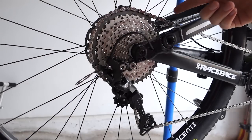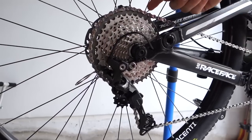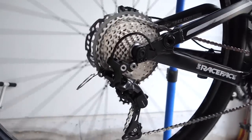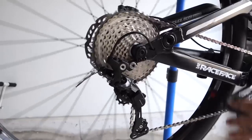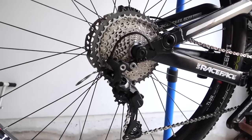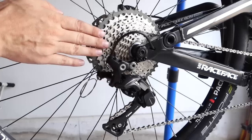The last thing I want to try is just to back-pedal while on the 42. The 42 in this case compared to the 10-speed is pushed in closer to the spokes, so the chain line is a bit more extreme. At 32 I'm fine, at 37 it looks okay back-pedaling, but at 42 the chain drops. The chain line right now is adjusted to be centered on the fifth cog, which is probably perfect — it's usually installed slightly biased towards the smaller cogs.